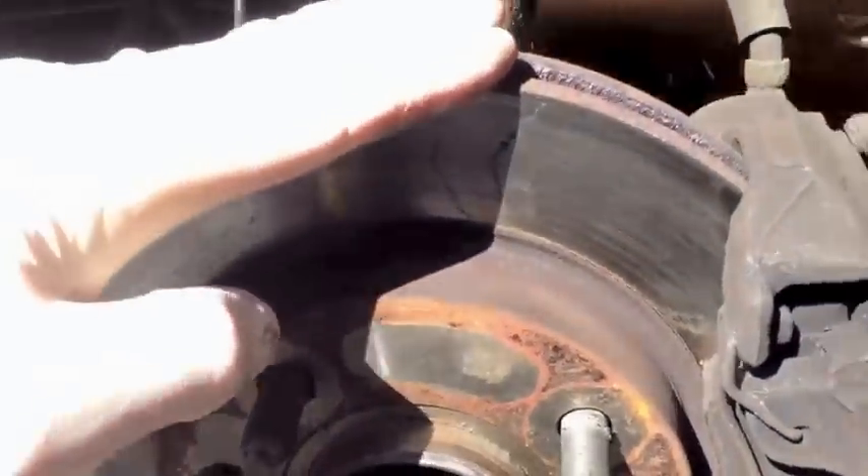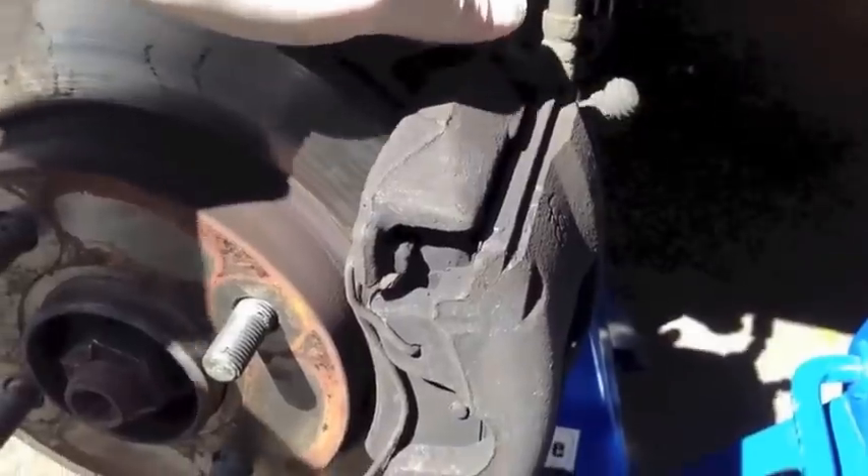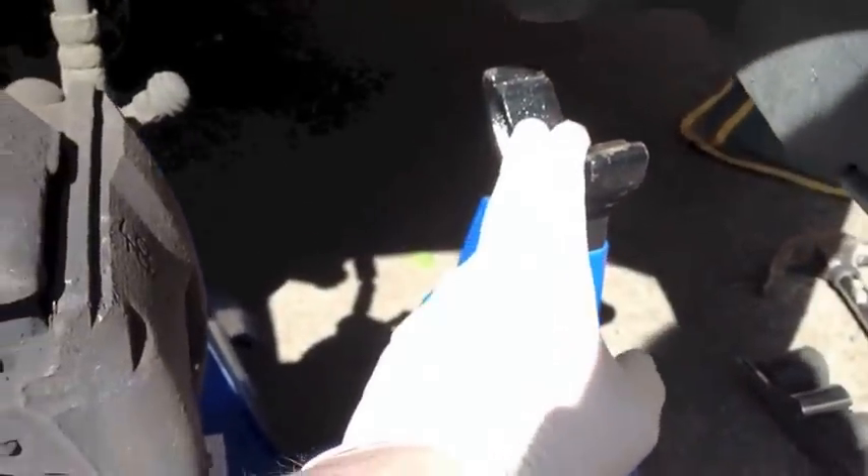There's a nut here. Let's get that off. Then take the brake rotor off, and there are two bolts here which take the caliper off — we can take that off in one piece. We don't need to take the brake pads out first. We've got an axle stand to put the brake caliper on, and we'll probably zip tie it to that.